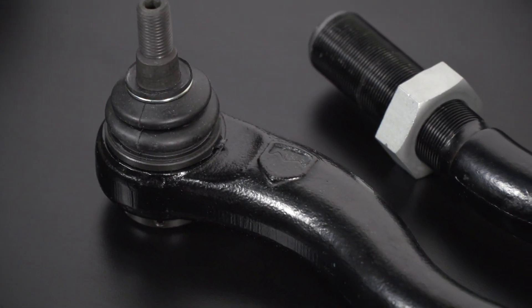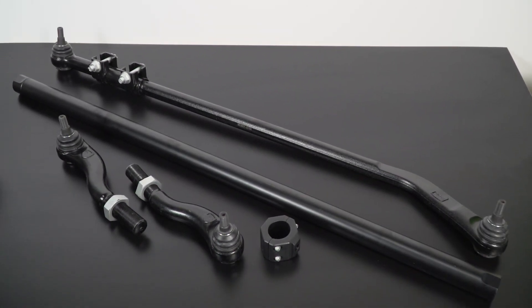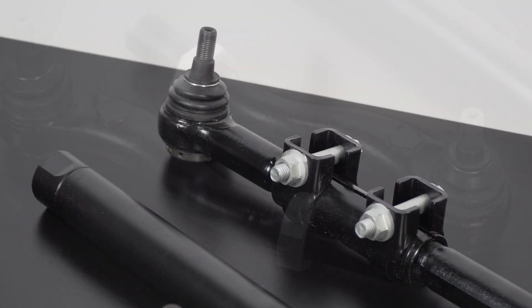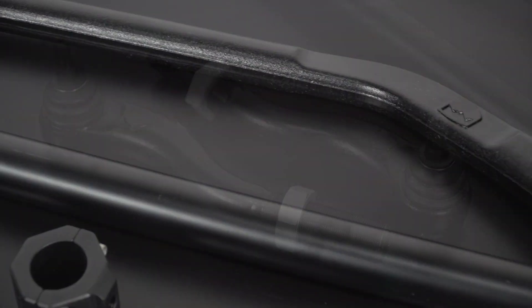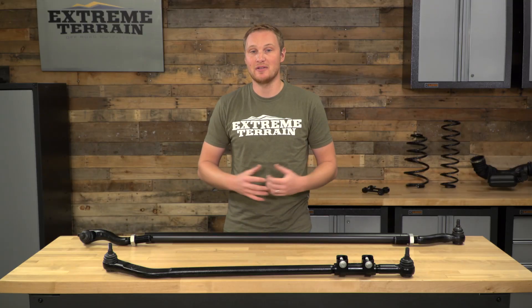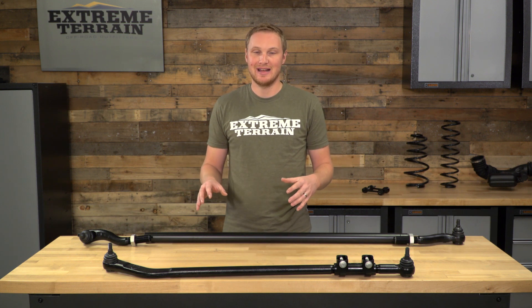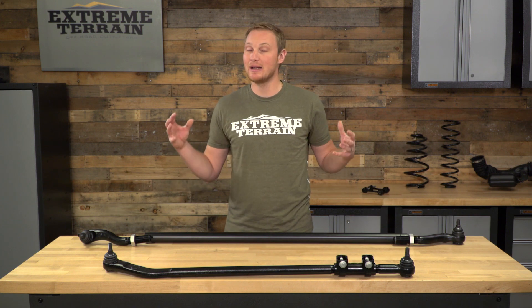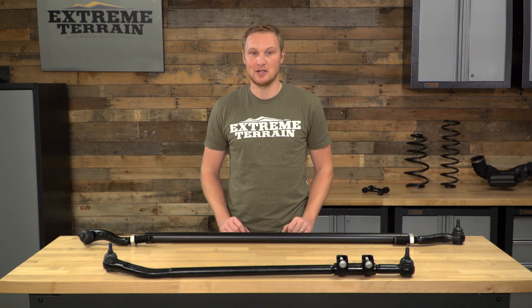This comes with very strong components that are also adjustable. These tie rod ends from TeraFlex are not only greasable, but they're also adjustable with a spanner wrench. You just have to loosen a couple of set screws and you can tighten up the preload on those. So if they ever do start to wear on you, if you feel like you have a little bit of additional play, you can go through and tighten everything up — you don't have to replace anything, it doesn't cost you anything. And that's not something that can be said about a lot of the other steering setups on the market. They may be very strong, but if they do eventually wear out, you're going to be purchasing new replacement parts. With these, you can adjust them.